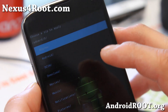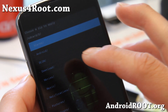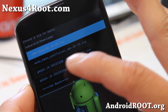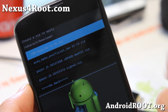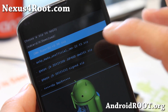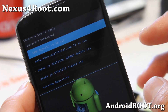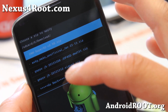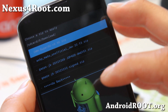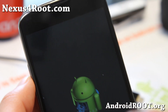Go to 0 and then find the file in your internal storage. If you downloaded it straight to your phone, it's usually in the download directory. You'll see I've got AOKP Mako unofficial — AOKP is the ROM name, Mako is the code name for this phone; Nexus 4 is the Mako. All the ROM files are going to be in the zip file. You can also see my GApps file — that's Google Apps in a separate file. If you don't flash the Google Apps you will not get Play Store. So install the ROM first, then Google Apps. Go ahead and click on the ROM and say yes.